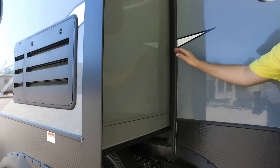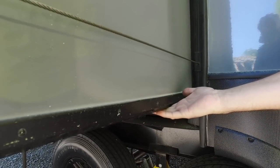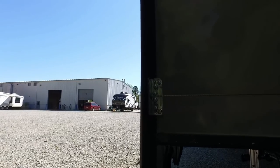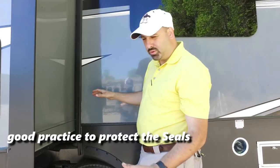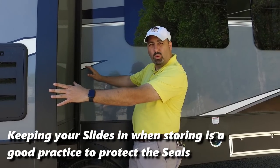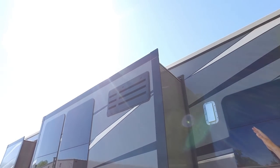The slides have wiper seals right here — you can see the seal, plus a glazing and a bottom seal. If you look at the back of this slide, it comes out about four inches and actually protects the wipers. The sun will get on these wipers, dry them out, crack them, and allow water intrusion. If you're storing your unit, keep your slides in — it protects those seals. Even if you have slide toppers, it can disintegrate the edges of the roof, so make sure that area is covered.